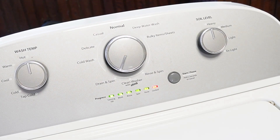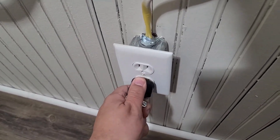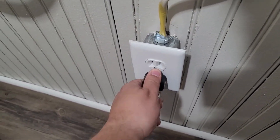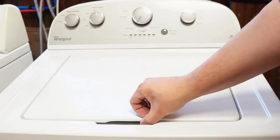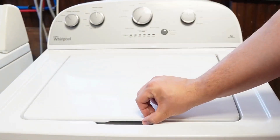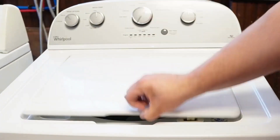When the calibration mode is at the end, every single light is going to turn off — including the lid lock light — and the machine is now ready and recalibrated for use at an optimal level. Now let's try one more reset technique. Unplug the washing machine and let it sit for about one minute to drain any capacitors or memory, just like we did the first time. Then plug the washing machine back in, let it sit for a few moments, then open and close the lid six times in under 12 seconds. This works on some but not all models, and it will issue a reset command to clear any issues beyond what the reboot or reset mode accomplished.